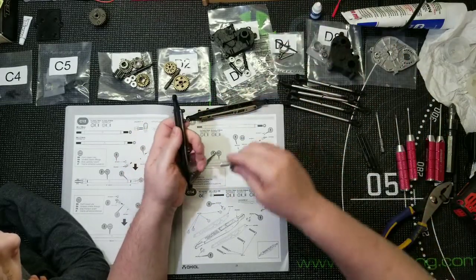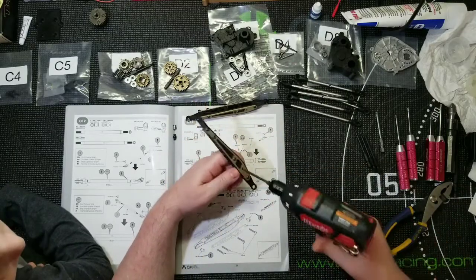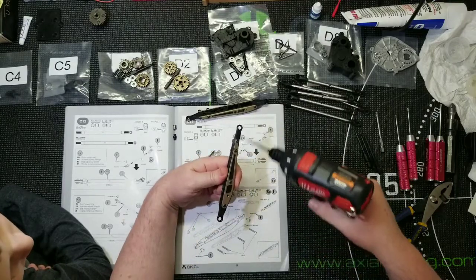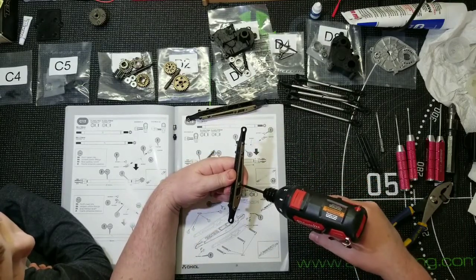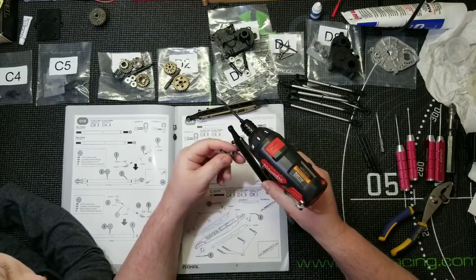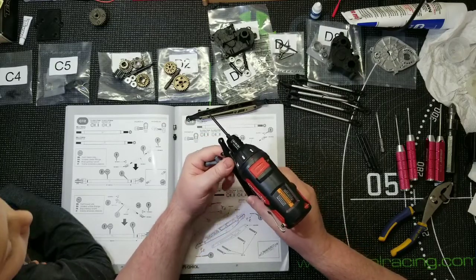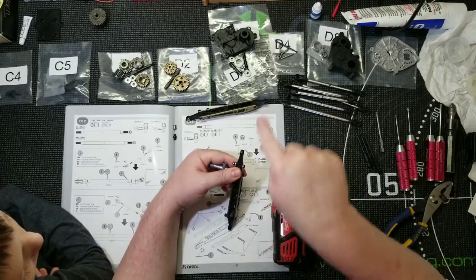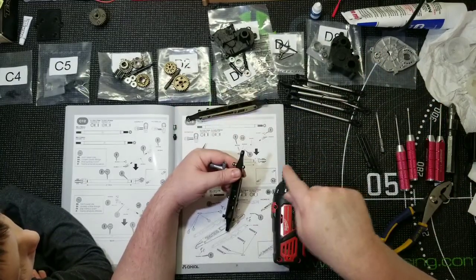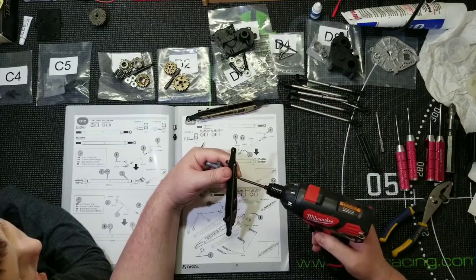And we need this. And this. We'll start with the middle one. Whenever you're doing long stuff like this, it's better to work from the inside out. Just like you do heads on a car. With heads on a car, there's usually like 8 bolts or 10 bolts. And you start with the center 2, and then you go this way, this way, crisscross pattern, and work your way from the center out, doing the same thing.